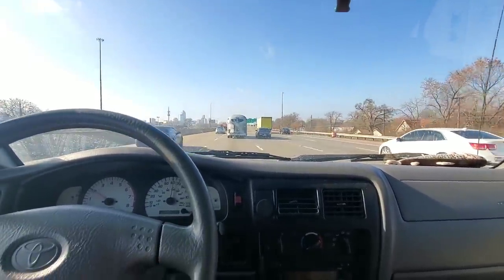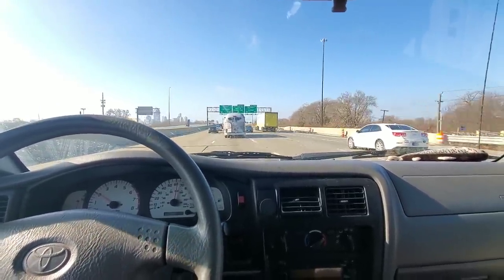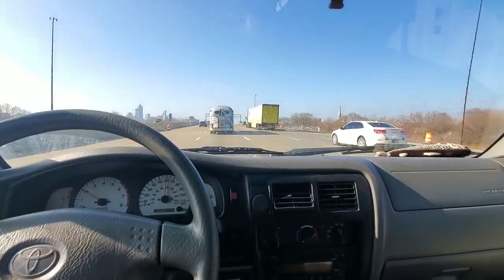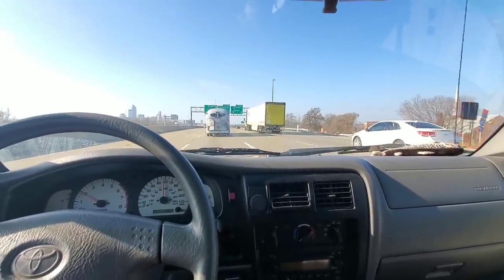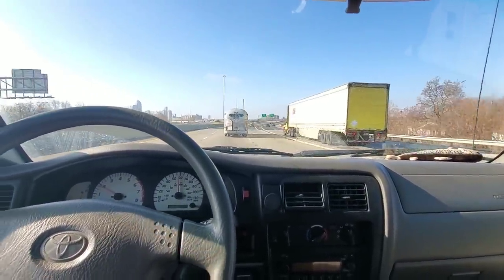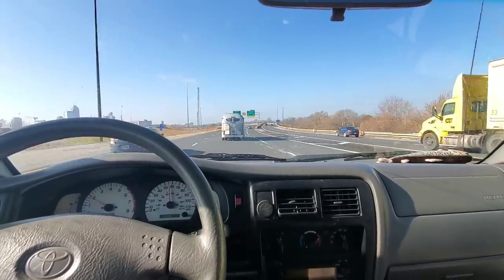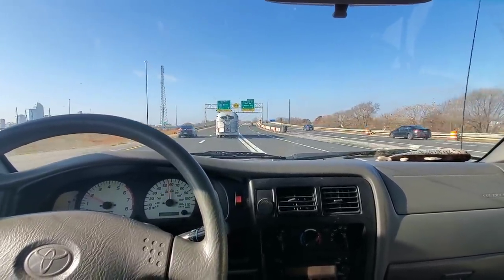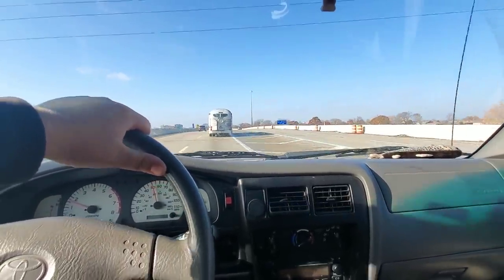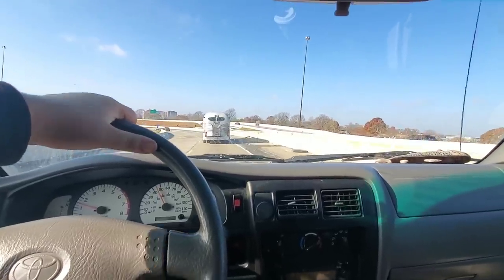There's Indianapolis — so it's about 40 miles from here to Chris's shop. We're doing pretty good today, or at least closer than we were. I think that roll pin is going to be a pretty good repair until we can get a new clevis for it. Obviously when it's been welded, it's been a problem for a while, and welding cast is never a great option. This will at least be good enough to keep it going until we locate another clevis. At this point it works, but it's not adjustable — so as there's wear, you can't adjust the linkage to compensate for that.